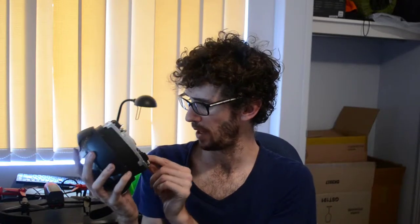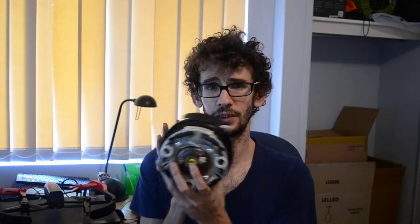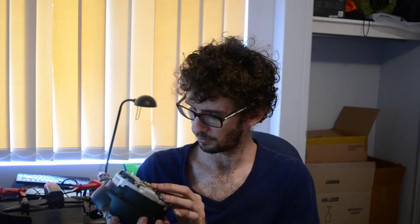What happened today? Today was a failure and a success, I guess. Failure number one — this took an hour and a half, maybe longer, to get off because there was always one clip that wouldn't go. This guy right here was melted to all buggery. Fortunately, however, the clip that goes into the airbag didn't melt — it blew out and it's actually blown itself sideways at an angle, but it disconnected itself. So we don't have to worry about replacing that, soldering anything, or crimping anything. That replacement will go straight in.